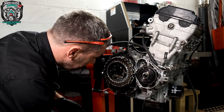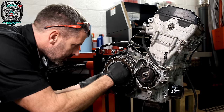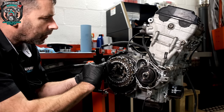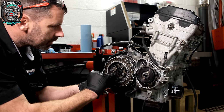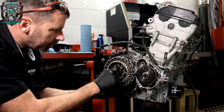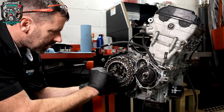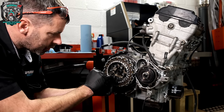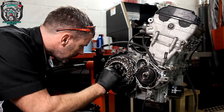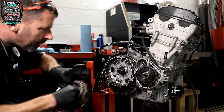The nut has a little ridge on it — this is a spline shaft — with a little ridge that you punch in. Instead of having a tab washer you fold over, you use a centre punch and knock it in. What it's done is make a little mark on the shaft, which means this doesn't want to come out.